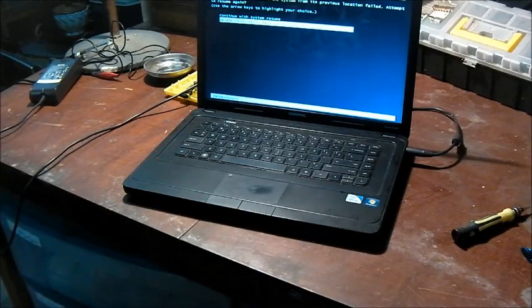So those are some steps you can do to try to fix your laptop. Hopefully that helps you fix your problem. Just to rehash: step one, check your power supply. Step two, unplug the battery, power off and on, then plug the battery and power back in. Step three, reseat the memory. Hopefully one of those steps will fix you — those are the three common easy things you can do to fix your laptop computer. Other than that, it starts getting deep into taking it apart and getting deep into the system. If you enjoyed this video, please like and subscribe, and always visit computerrepairclub.com. Feel free to ask any questions.